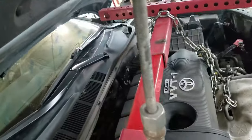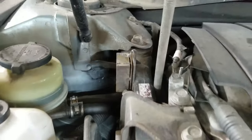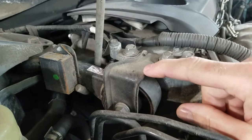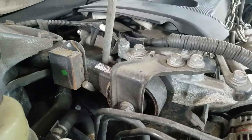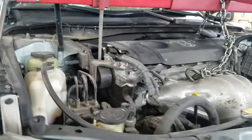I realized I had to put one of these threaded rods on here too — I just wrapped it around the dog bone like so. Because on the front, this mount's going to be the only thing holding up the front of the engine. So when I take the cradle out, this is going to go down and swing out. So that should hold it up there pretty good.